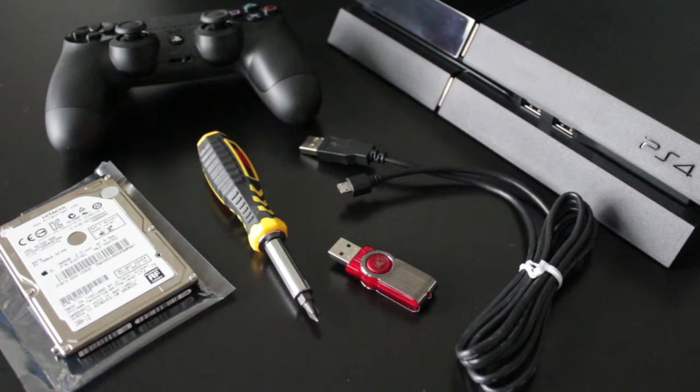To ensure that this process runs smoothly I'm going to go through everything you're going to need — I'll also link you to everything in the description down below. First off you'll need a hard drive, and you can choose between an SSD or an HDD. It's totally up to you and what you're planning to do with the PS4. Any 2.5 inch laptop hard drive should work as long as it's no thicker than 9.5 millimeters and no smaller than 160 gigabytes.